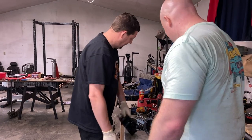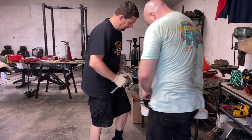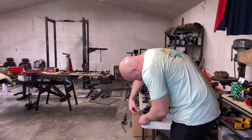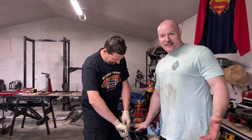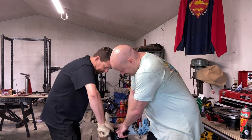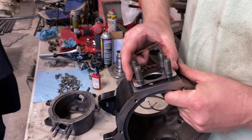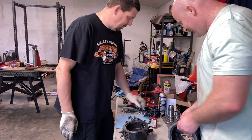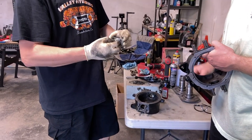Now, so that's one done — so far you haven't acted weird yet. The day's young. Last thing on the shims: we do thin shim and then thick shim, same for the other side. Make sure after you paint the knuckles that there's no paint in here or on here — otherwise they will not slide together because it's such a precise fit. In this case Ben did some really good paint work on that side, which we need to clean up.